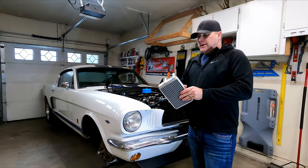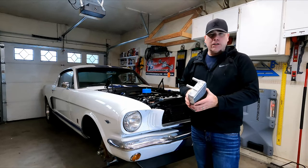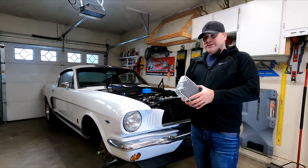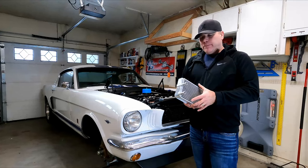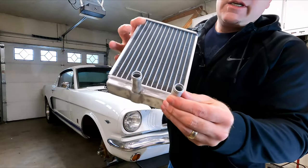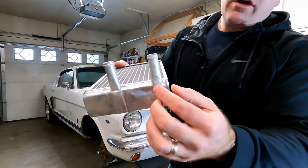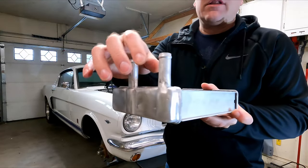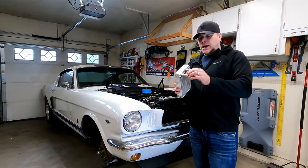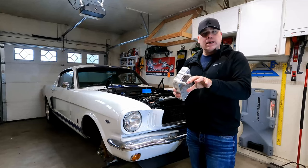I could not find a leak on this thing. These things are relatively cheap, so I just ordered a new one and put it in the car — same problem. The new one is leaking as well, but this time I think I know what's wrong. If you look at these tubes, they're round and fairly circular at the end, but as you get towards the end caps of this core, they taper down and oval out a little bit. I'm wondering if maybe I put the clamp too far down on the tube, closer to the oval part, and as it's trying to clamp, it can't clamp around an oval like it can around a circle.